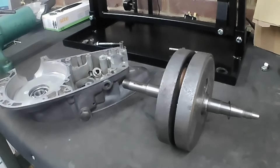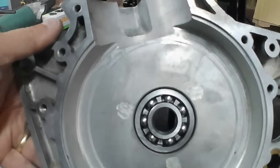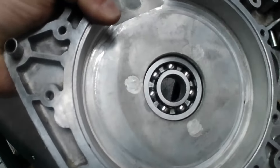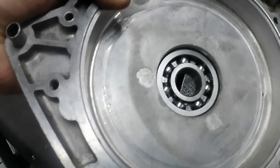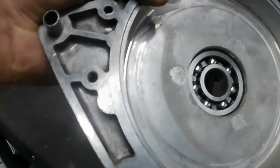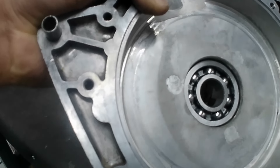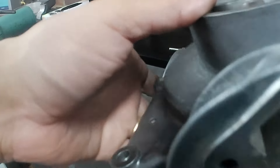Let's do the end float. I've already fitted the main bearings in the casings by warming up the casings — I try not to hit bearings wherever possible. If you just hit them on the outside you might get a misalignment and take a sliver off your casing, which further down the line can lead to slack fits between your bearing and casing. Wherever possible I use heat and they just drop in.